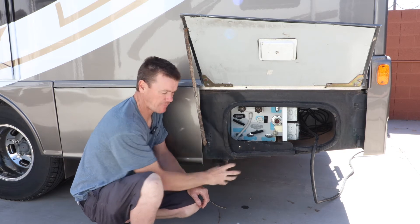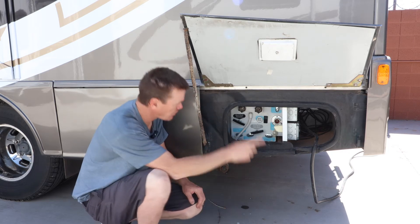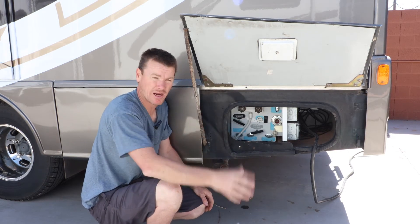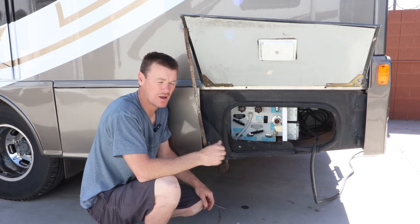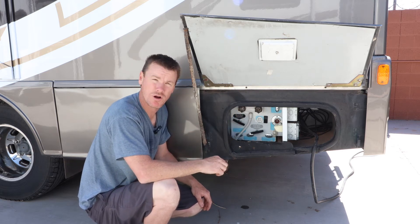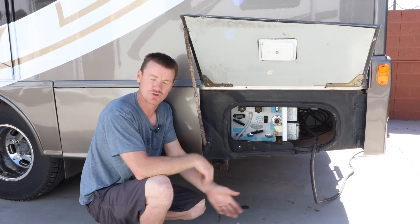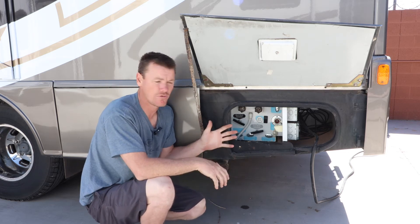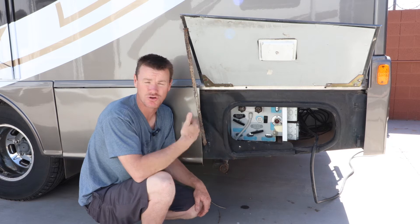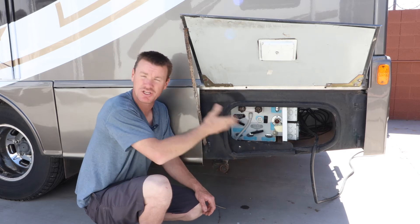There's a cap right here — take it off, half clip off. You'll see claws there; go half clip on and make sure everything is very secure. Once secured, pull the black waste valve toward you about four inches, and you'll hear all the black come out — that is toilet water. After you drain that, shut it and pull the gray valve. Gray is what flushes and cleans that out as well. If you're staying somewhere for a couple of days, you can leave both valves open so you don't have to worry about your tanks filling up. Before you leave, shut both valves. If you're not sure whether you went to the bathroom or showered last, run some fresh water through the kitchen sink for a few minutes, then come out here and pull gray to flush and clean your water hose out.